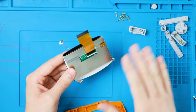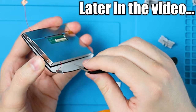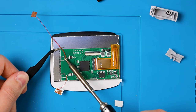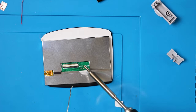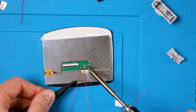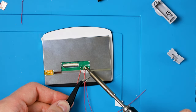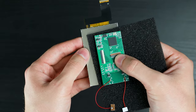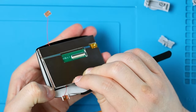My one gripe with the installation is the shielding. It's really nice to have everything in one piece and put together for any potential beginners, but it's kind of hard to remove the shielding. Unfortunately, I may have broken my screen trying to do this, which is something you'll have to do if you want to remove the touchpads. It'd be a lot better if there were cutouts for the touchpads like the other solder points. You really shouldn't solder on top of your screen. If you heat up your LCD for too long, it can cause dark spots. So you need to be really quick. Maybe try to create a little more separation between the board and the screen, and make it easier to remove the shielding. But other than that, installation was a breeze.